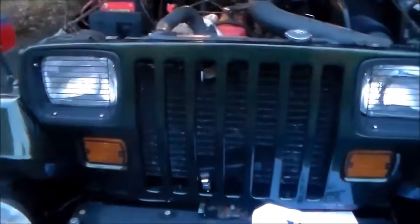All right, my friends. So here we are, day two. Dusk again when I finally had time to work on this thing. So you see where we left off. You got the Tuffy lock inside where it needs to be. So all we're going to do is remove the factory hood latch, the three Torx bits. Looks like Torx 30. I oiled them up earlier because they were kind of rusty and nasty. And they did say you should put tape over the hood lock when you're sliding it in to protect it.